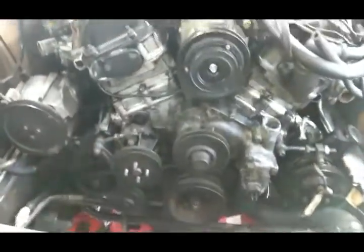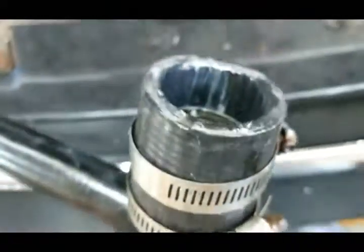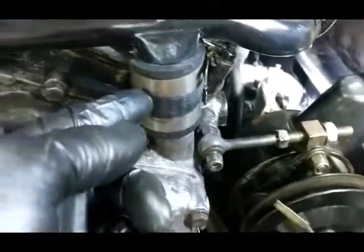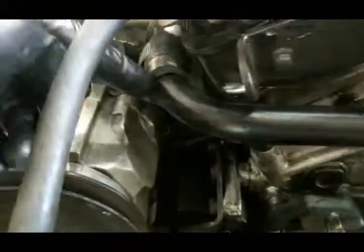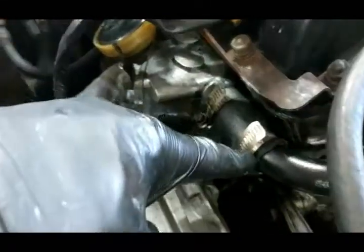I tried for a few minutes, and what I realised is that you've got to push these right onto the fitting here, as tight up as you can get them, and then you can get it on. I also removed this piece — just a bolt — but it was a guidance there on getting it on easily. That's on now. It was a tough thing to get on — all of these pipes went right up and right in, and then I could put the pipe on and slide the little stretches of hose back.